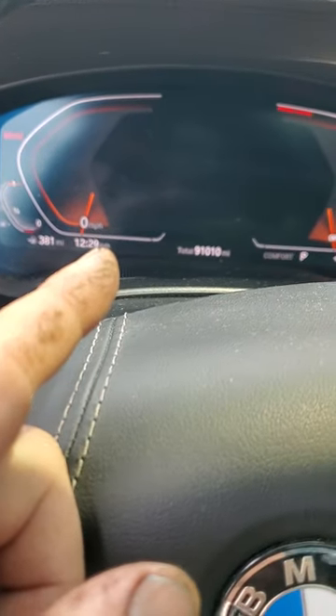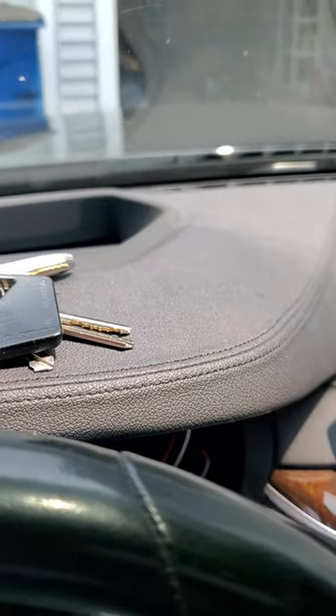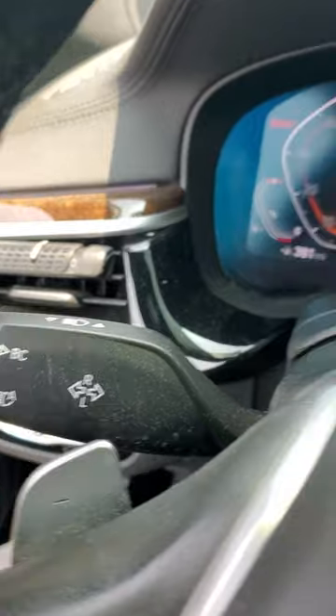I'm going to tell you why your brake pad won't reset on a newer BMW. The door has to be shut or latched manually. Make sure the hood's shut. Triple press the start — that turns on Diag Mode. Clear the messages with the BC button.